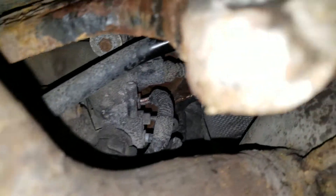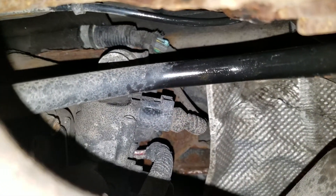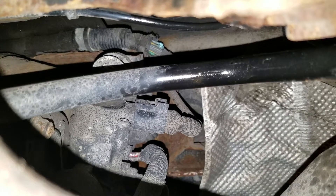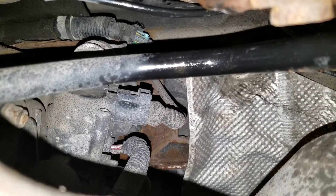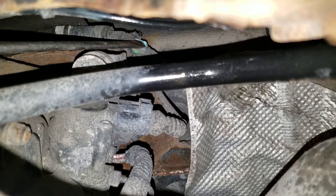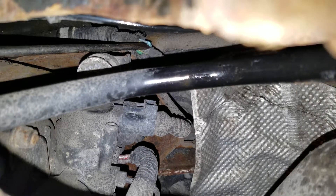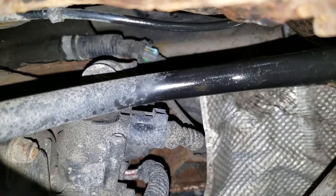By a stroke of million-dollar luck, I'm poking around up here at my compressor and I look just above it — you can see that blue dot in the wiring harness. My camera is so close to my face it's blurry, but I knocked a bunch of blue fuzz coming off of it with my screwdriver — see all that stuff coming down. That's the wire I'm looking for: gray with a blue stripe. That's the broken wire. Hopefully there aren't many more up there broken with it.